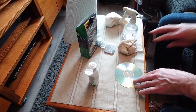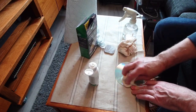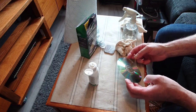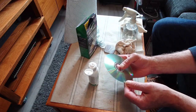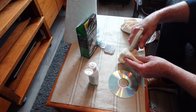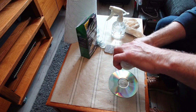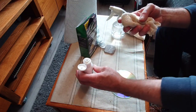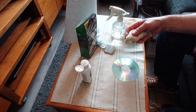I'll show you this again now just to show you how well this process has worked. Usually the reason a disc skips is generally not to do with the plating — it's to do with the underneath, which is the plastic. It's looking pretty good already and I'm only a few minutes into it. If you spend a bit of time and patience on it you can get this like brand new. Always add a bit more water onto the cloth you're using. I'll crack on and speed this up a bit so you don't get bored.